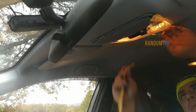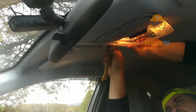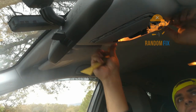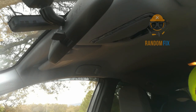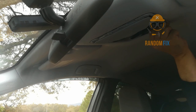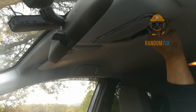I'm removing the trim just using my plastic pry bar, going around the actual dome light area — and there it is. Now the lights are there. I'm going to have to turn these off so they're not too hot. The trick is you want to have either a cloth towel, or in some cases I really like to use electric tape or painters tape — I'll put it around the light bulb and gently pull.